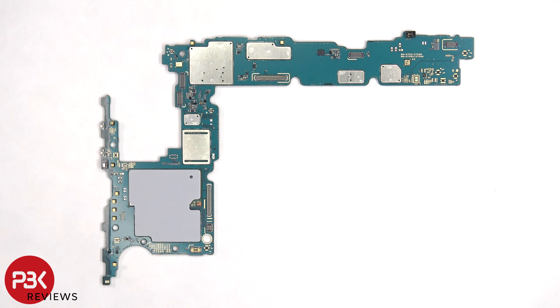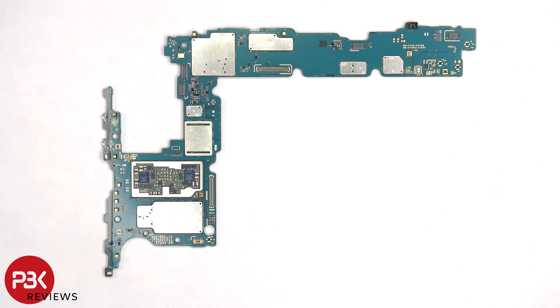Taking a closer look at the main board, there are two proximity sensors — one located here and the other one on this side. There's a third microphone located here on the board, and there's graphite film over the shields to help transfer heat. Here's a better look at it with the graphite film removed.